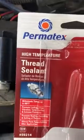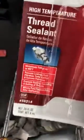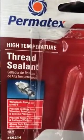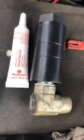And then before putting it in here, once you screw it in here, it's best to use this thread sealer that is more recommended. They show some videos where you can use Teflon tape, but it's better to use this. It's more professionally done, and you won't maybe have to replace the part again. So it's best just to buy this, and it's no more than $10, this piece right here, which is this too. And I was just reading the instructions, and it says not to put it all over the thread except for the last thread, to leave that one, and then just put it in there.